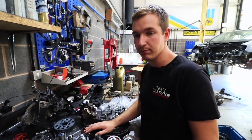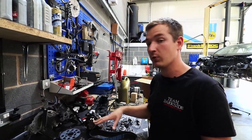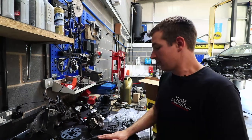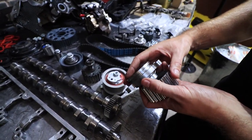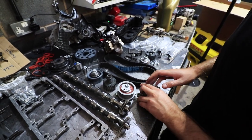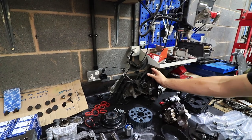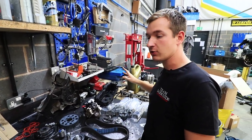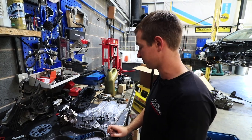I think VW just went thinner because they never had any belt failures, and then decided to introduce a failure — because things like the Crafter vans with a 20mm belt are failing all the time. So it's a worthwhile upgrade; it's a few hundred quid extra, but you know it's done right and done once, and then the timing belt cost is no more expensive next time round. You need the extra pulleys and stuff to make it right. This little pulley and this little blank is what we use to blank the water pump off with, then we use this pulley to replace the water pump and keep the belt in tension. You've also got to run a timing belt cover on a track car — you can't run without one, otherwise you'll end up with gravel stuck between your belt, and gravel doesn't move but your belt does, which ends in tears.